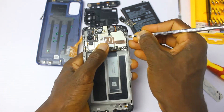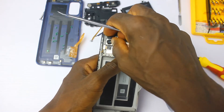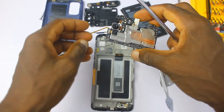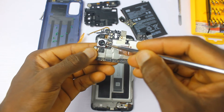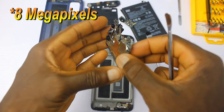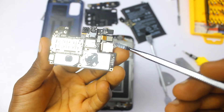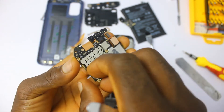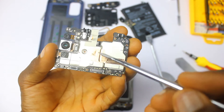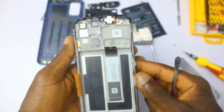The main board of the device houses the 48 megapixel triple rear camera, the chipset, and a bunch of other things — including the SIM card tray. Right here you can see the 48 megapixel main sensor, the 2 megapixel depth sensor, and the 2 megapixel macro. Up front is the 16 megapixel selfie camera that can shoot 1080p video at 30 frames per second. The chipset is the Qualcomm Snapdragon 662, covered by a copper heat spreader and it also has some thermal paste, which is good.